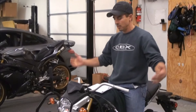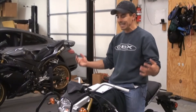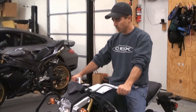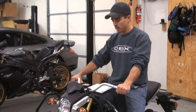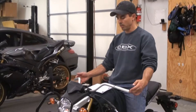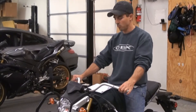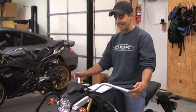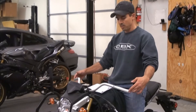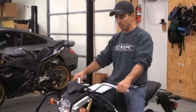There will be some variances, but this is all supposed to be used as just an idea of what you want to do and how you want to do it. We got the Rode High Silvers on here, and these are OEM replacement — they're 120mm height versus stock which are 140mm. Once we've mounted these and tried to get the same angle as the stock ones, the height off the ground is now 890mm versus stock at 960mm. So they're going to be that much lower, and the swept back is about 165mm, so they're a little bit farther forward.